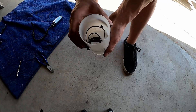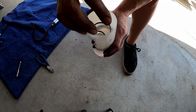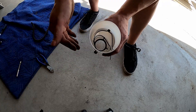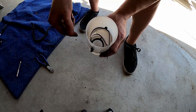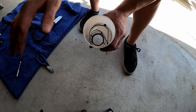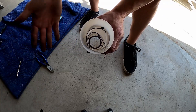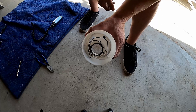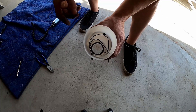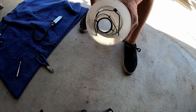Just make sure when you do this modification, clean it thoroughly. Get all the shavings off — get as much of that plastic residue off so it doesn't get sucked into the bottom of the gas tank and start clogging up the sock filter. Anyway, that's it. See you guys here shortly.